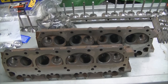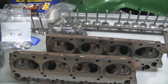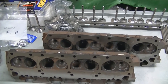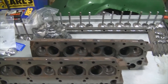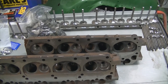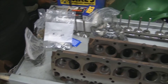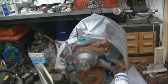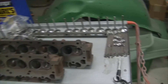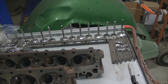But the push rods were too long now. I did take a push rod checker, set the head up with a lifter, and did get a measurement on it. That measurement was 8.455 or 8.459 — somewhere in that area — for the new push rods. The factory push rods for a 383 are 8.55 from 1968 and going up. So the motor is still sitting here. I did order those push rods and they are factory 8.55 rods, and they are a scooch too long — not by much.